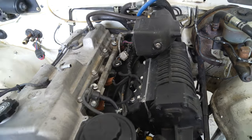Nothing's cut, nothing's broken. All right, so while we might have AC in the future, we don't have AC right now. So I'm gonna go ahead and use this AC fuse and the outlet of it to power our wideband. I'm gonna change the fuse from a 10 to a 5 because that's what it calls for, a 5 amp fuse. And that will solve the issue for power to our wideband. And then this slick little unit that I built will be functional. I'm sorry, I said wideband, I meant boost. It's boost. So yeah, that's what we're gonna do here. So we're just gonna get this dialed in, then we'll take it for a quick rip.